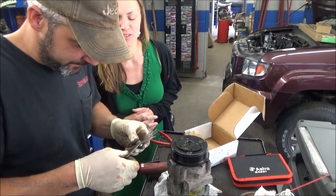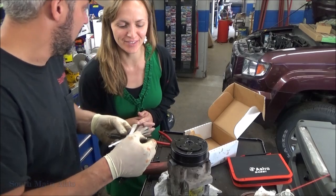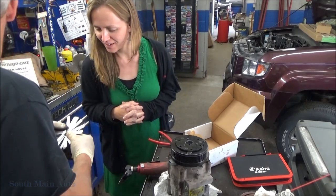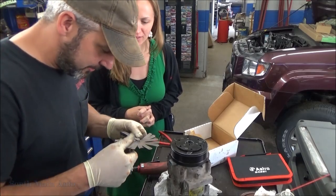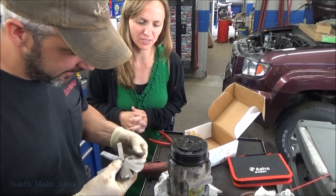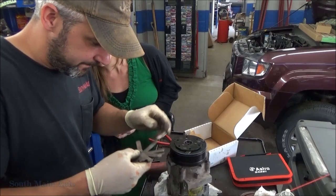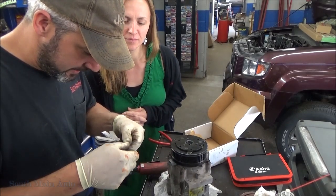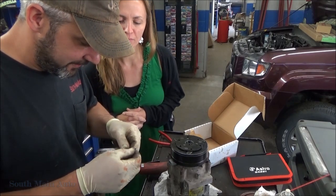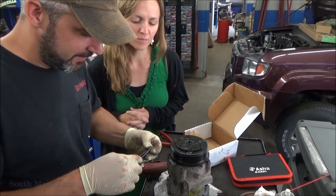Let's see, where are we at? So, what? Just get one that fits and be like, oh, that's good. Well, look at our tolerance. 0.35. I know, but you tried like 5 of them. I know, but I'm trying to look for a thicker one. One that just fits, and then what? And then if it's within its tolerance. You ask too many questions. So that one is 0.508. What's 508 plus? Let's get up to our 0.75. So that's 50 and 25 is 75, right? Last I looked. But that one's all freaking bent up.